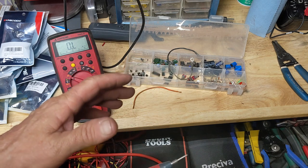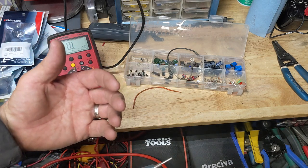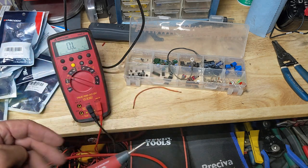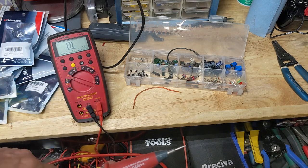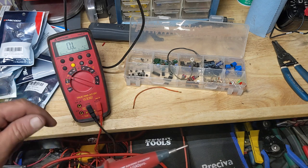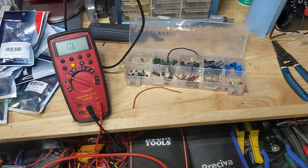Remember when I was talking about pixies and resistance? You don't want resistance in your wiring. There's resistance in all wiring, and that's why you have to size wire based on the current flowing through it. So all wire has some resistance. But a good wire, properly installed and properly sized, will have very low resistance.